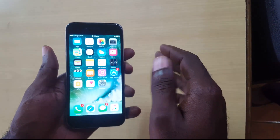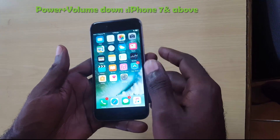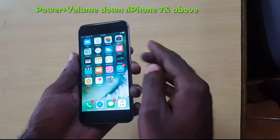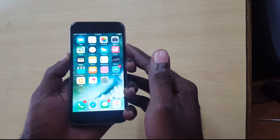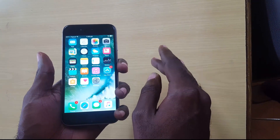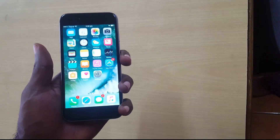Your display will start working again. If you have a newer iPhone such as the iPhone 7 or above, you want to do a similar thing except the home button doesn't work this time — you're gonna hold down power and volume down. Your phone will restart and you should have your display working again as usual.